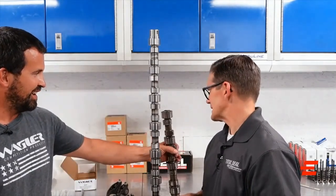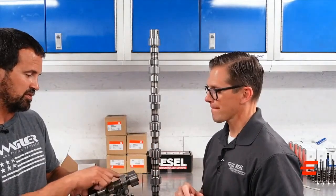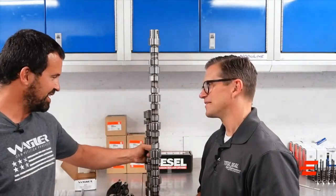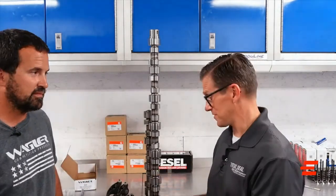It's working, unlike the old factory setup. As for why the camshaft is short — whenever we see them eating the lobes, this one isn't even the worst. We've seen them dig all the way across, and that material goes right into the rod bearings, seizes up the rod bearings. This one chucked the rod right out the side — half a camshaft, junk block, junk crank, junk everything. We're seeing this at low mileage, anywhere from 40,000 to 100,000 miles.